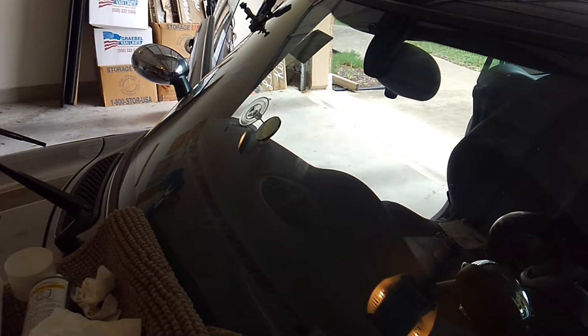It's been close to ten minutes. This one filled in pretty quick and easy. You can tell where the damage is, but it's definitely much harder to see at this point — the resin has worked its way through. The biggest mistake I've noticed over ten years of doing this is that a lot of repairmen go as quickly as possible. The key to fixing these right and making them look really good is time — just giving it enough time to work its way through. That one is almost there, so give it ten, maybe fifteen minutes instead of two or three.